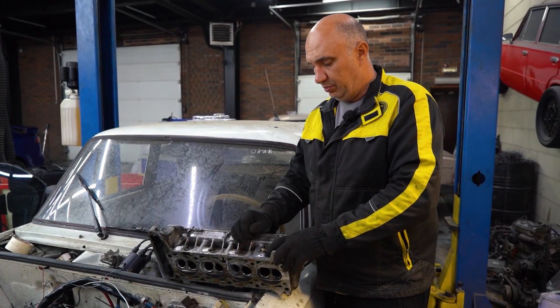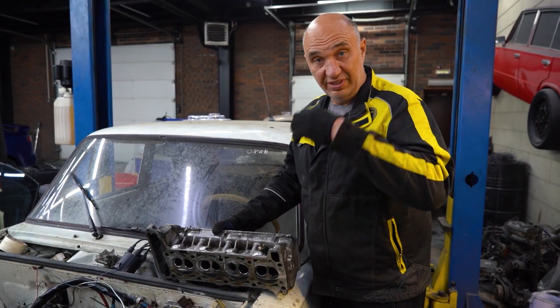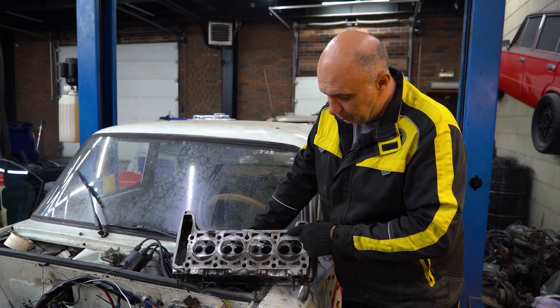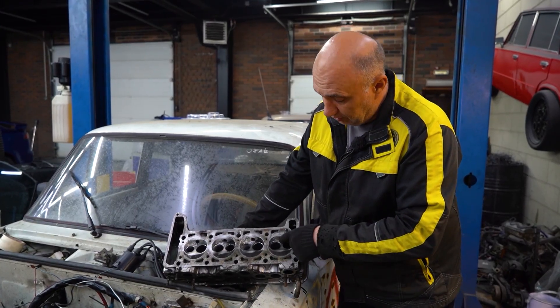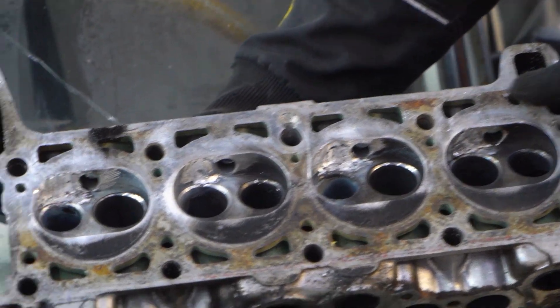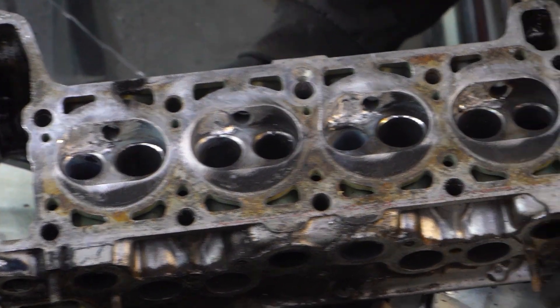We needed to make an additional hole into the combustion chamber, but this wasn't exactly simple. A lot of the space is hollow because of the cooling for the cylinder head, so no matter where we drilled, we'd always hit the water jacket. So we drilled through the side of the cylinder head in order to access the combustion chambers, and we welded in some plugs. Now the reason this cylinder head is just lying there unfurnished is that we ran into a certain issue.